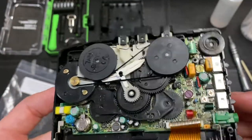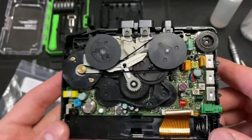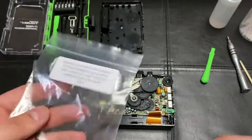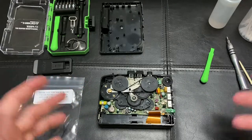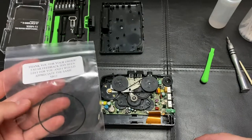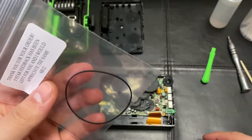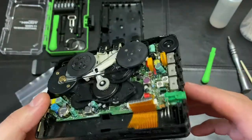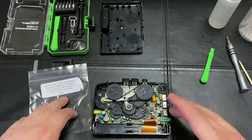It's pretty simple — at least with this one I should be able to just pull it out. To find the right belt, just type the model number of the Walkman on eBay. You could also check that seller, or look for forums for your particular model. It's mostly the Sonys and more popular models, but the seller said this belt covered multiple different Walkmans. You can also get universal or variety packs with a whole bunch of them. And if you're really determined and can't find one, a thin enough o-ring or rubber band could probably work something out.